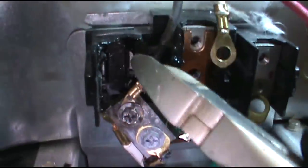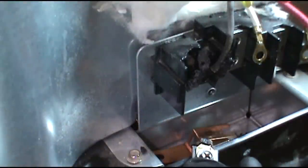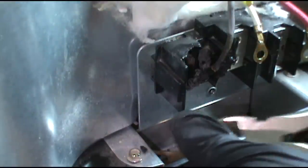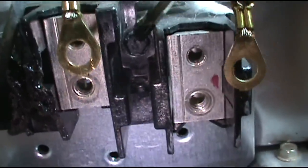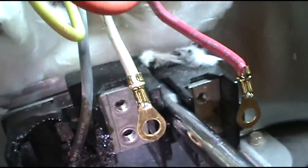I'm just going to put in a new black wire. Set this down here, pull the cord out. Major surgery here. To get the terminal block off, you have to undo that screw right there, and that one right there. Just get in that driver and it should come right off.